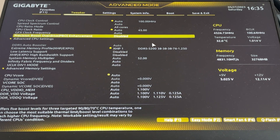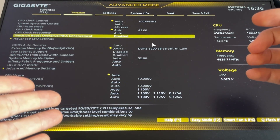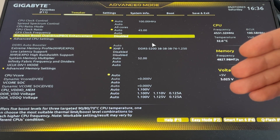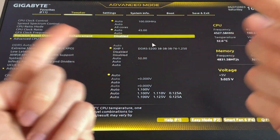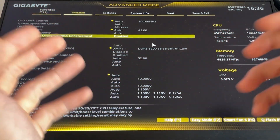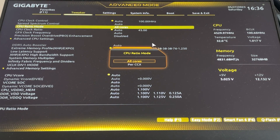Now let's talk about the other option: static frequency and static voltage offset. This will transform your CPU from a curve optimizer setup to a good old static CPU. When it's not under load it stays at base frequency; when it is under load it goes to the high frequency and voltage we set. This extends the life of your CPU slightly, dramatically reduces power consumption — the first method reduces it 20 to 50 watts, this method reduces it 50 to 100 watts — and it slightly increases performance in productivity applications that use heavy AVX instructions.